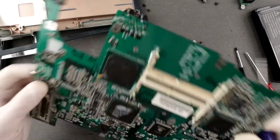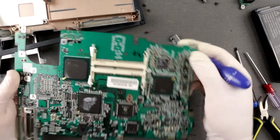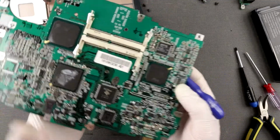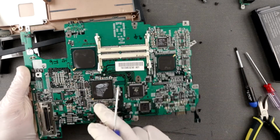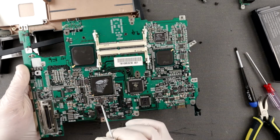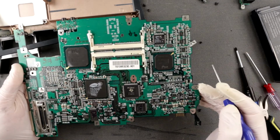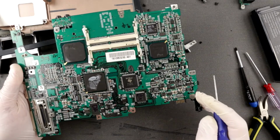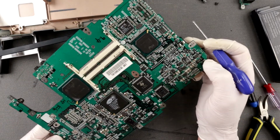Inductors, again, as I mentioned before, so I looked a little bit in detail. These guys turn out to be LMV324. Those are op amps, can be recycled. Few resonators, one resonator, two, three. Again, some weird 14.318 megahertz, 29, blah blah blah megahertz, 49.158. Very odd numbers, yeah. There are current shunts, one, two, three current shunts can be. Those guys are, what are they again? I forgot.